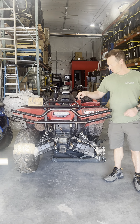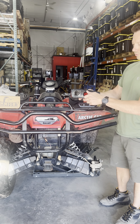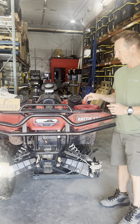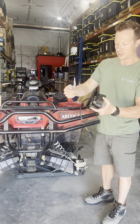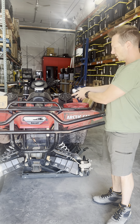This is the new tail light. You have a tail light that looks like this. You're going to remove the light that was in it and unscrew it from the back of your quad. Take that off, and then the new tail light goes on with the supplied hardware. There are two screws that screw into these holes, so just slide this through and put those two bolts in there.